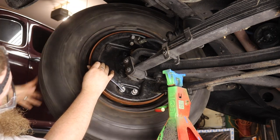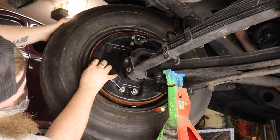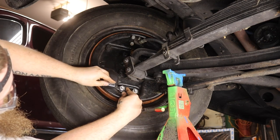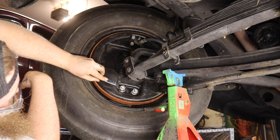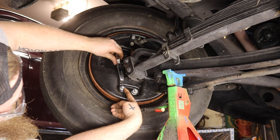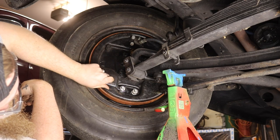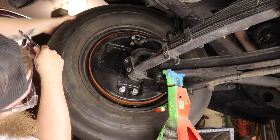What we're going to do is just tighten it until it just starts to drag. These are very subtle adjustments — just starting to drag. Now I'm going to tighten that up. The problem is on some of the older cars, it's a little gummy — spinning this lock nut will spin the adjuster. So I'm going to watch it and feel it to make sure it doesn't spin. If it doesn't spin, we just locked in our first of four adjustments. I locked that in — see how it feels — just a slight drag. That's how I like it.